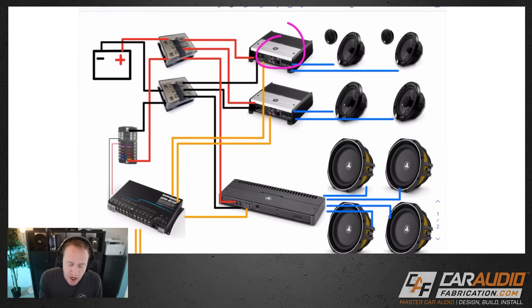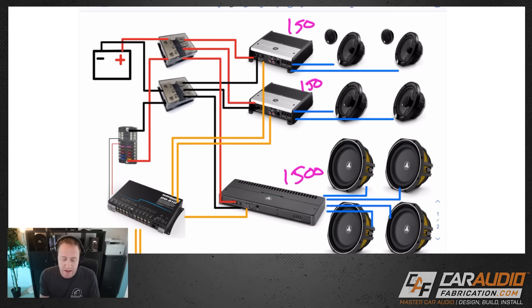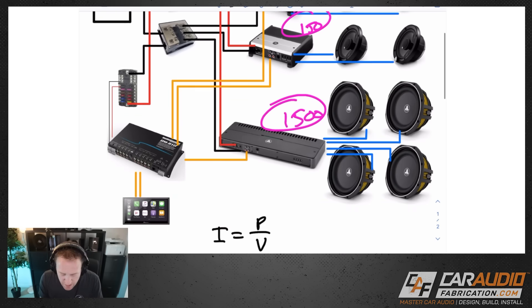As an example, these two-channel amps can do 100 watts per channel at 2 ohms, but I'm using a passive crossover and running at 4 ohms — so each amp is 75 watts times two at 4 ohms, which equals 150 watts per amp. The subwoofer amplifier can do 1500 watts at 1 or 2 ohms. I'm going to use as much power as possible, so that's 1500 watts. Adding it all together: 1500 plus 150 plus 150 equals 1800 watts total system power.